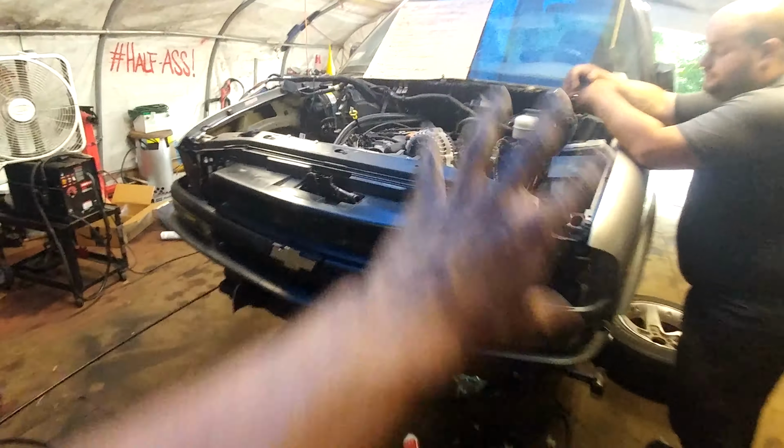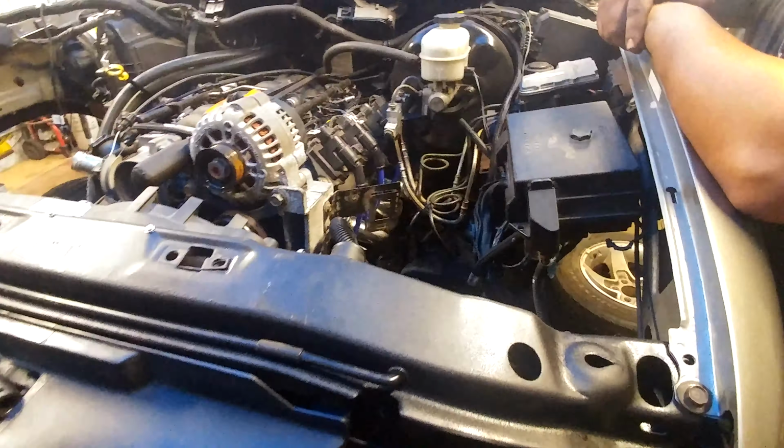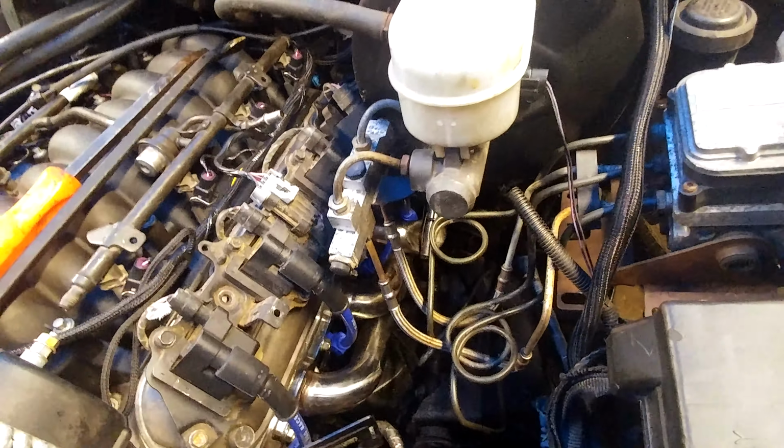Going on here is the steering shaft work. As you can tell, the nose got snugged down a bit here. We're going to line up the fenders, but this is good enough for now until we go to do body work. We have to slightly modify the exhaust manifold, as you can see down there, and we had to shim the starter so that it tilts this way.